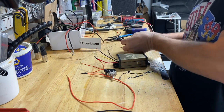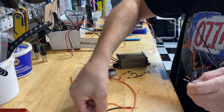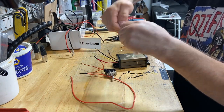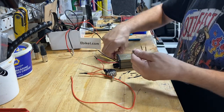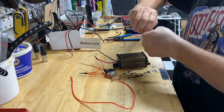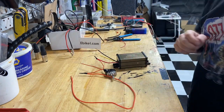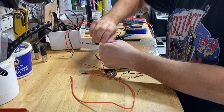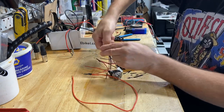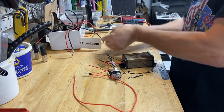Now I'm going to do all the shared minus — the B-negative. It's all going to be shared. This goes to the charge port because you have to have something going to the battery, so I'm going to share the battery charger input negative. That's going to be the negative for the multiple voltmeter I have in there. If you have a throttle that has the voltmeter on it with the key, you don't have to do this step with the voltmeter. I'm tying everything together on the negatives here. I put red on the positive wires — I like to be thrifty, so I'll mark them so I know which is B-plus and B-negative.